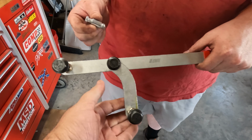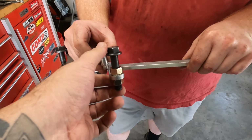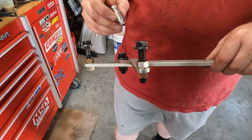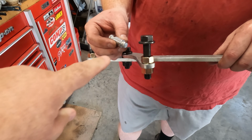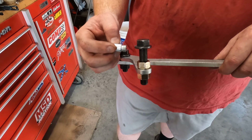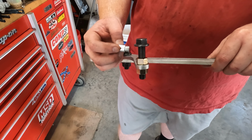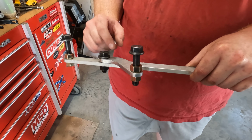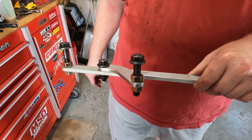Two hours later. All right, so as you can see, we have replaced the pins with some grade 8 half inch bolts, and in Keith's hand next to it is the pin that was on here, and that tiny little bit was what was threaded in. So nah, it wasn't working. We definitely aren't going to be ripping those out now. So on to actually trying to remove the sprocket.